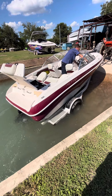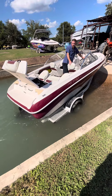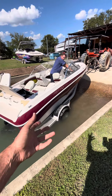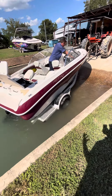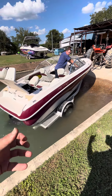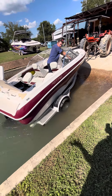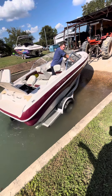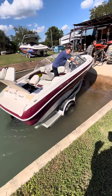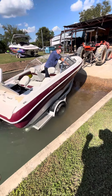That carburetor has had a little problems on the acceleration, but let's run a little bit more and see if that takes care of itself. Okay, give me full throttle now. Remember, when it's full throttle like that in the tank, the boat's not moving, so it's lugging. It's loading up with fuel. So when you chop the throttle a little too hard, it's overloaded with gas and the engine will stall on most carbureted engines. When you bring that throttle back, don't completely chop it. Let's say give it a little gas, put it up to 2000 RPMs, and then chop the throttle — let's see what happens.